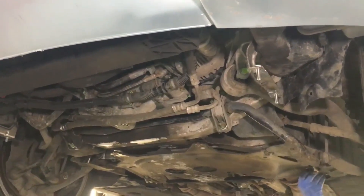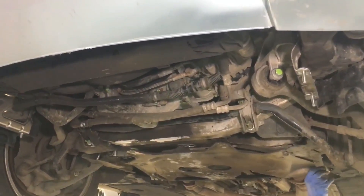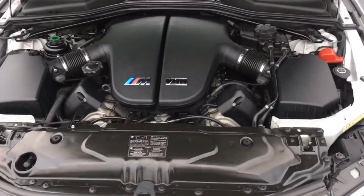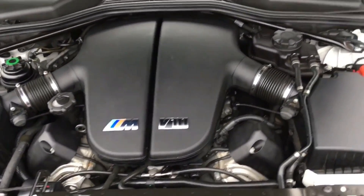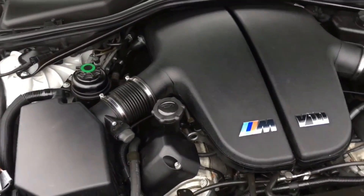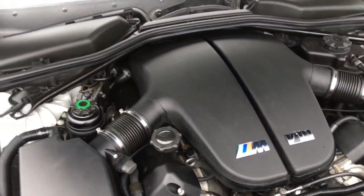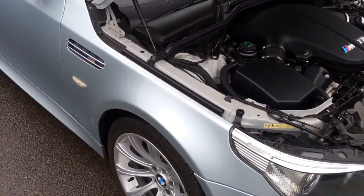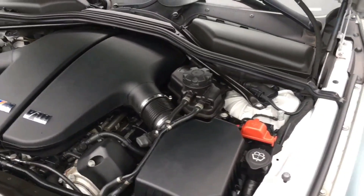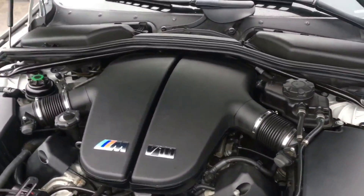The entire job is complete. The engine is running, it's done one heat cycle already, we've let it cool down and we're now running the engine again to get the correct level of oil in there and get a final oil reading. Everything is refitted underneath, torque checked correctly and paint marked. It's all back together - finished - after the BE bearing con rod bearing replacement, the BMW bolts, and the high pressure pipe that you saw us fitting earlier in the video. We've done some running and heat cycling, checked over everything, no leaks. The car's had new power steering fluid, been cleaned in the engine bay, and the customer is going to go and put some miles on it gently with little load for the first 500 miles as a form of running in. A successful E60 M5 S85 con rod bearing replacement at Relish Motorsport.